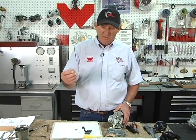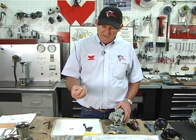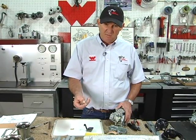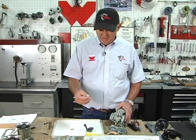The demand valve we discussed is in good shape. The ball rattles freely. You can increase the size of the pump jet. It's a calibrated part. There's a number on it that's in millimeters. You can put a bigger pump jet, or put a smaller pump jet in it.